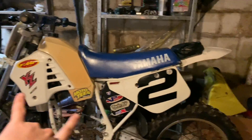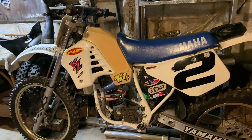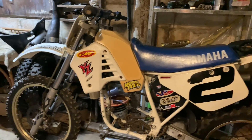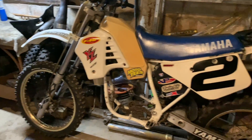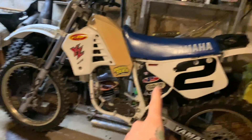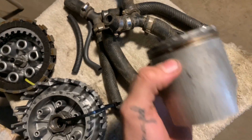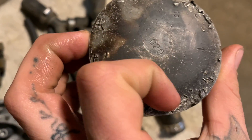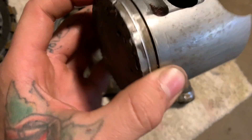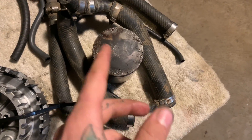This is not gonna be a daily — this is gonna be like a hill climber. I'm gonna get a nice little paddle tire for the back. Give me a couple weeks and this bike will be running, but the parts will be here in a couple days. I got the clutch plates, clutch basket, and this is the old piston. I sent it out to get a new piston — it says 0.20, so it was bored 20 over when I bought it. I couldn't find the piston rings for that size, so I went ahead and bought a bigger piston. Now it's bored 40 over.